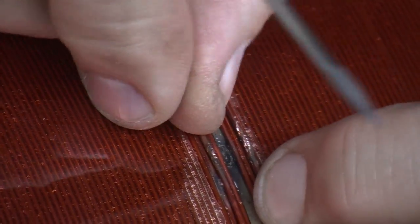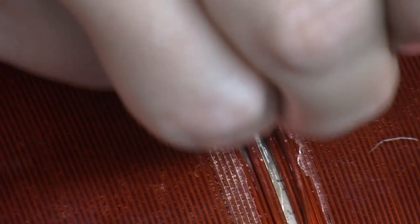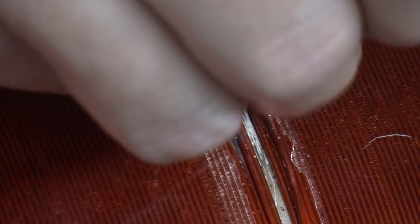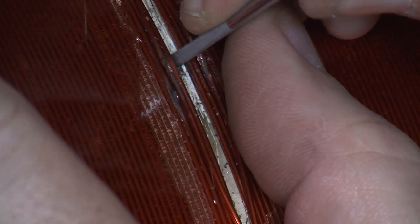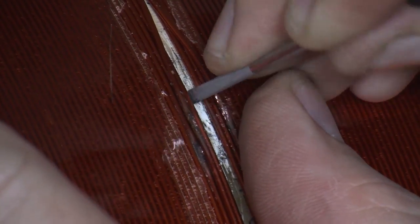In the bottom we have a nice spot of carbon where it's all black, so I'm just going to scrape that away. This is the coating that seeps through the wires to get down to the PVC — and the burned stuff as well. There's a bit of a pock mark on the tube itself that I'm attempting to scratch out. The idea is to get as much of the carbon out of there as I can. Our copper wires for the windings that are still on the tube look pretty good — I got almost all the black goo that was down in there out.